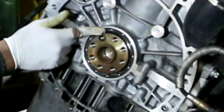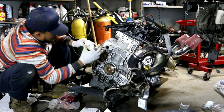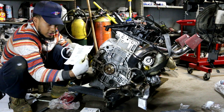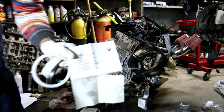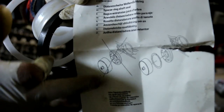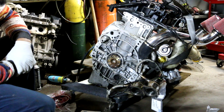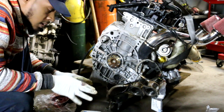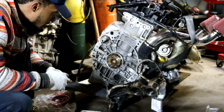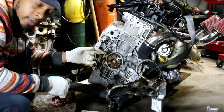This side went in a little far — I hope that doesn't cause any issues. There's a diagram actually showing you what to do. It looks like you're supposed to have another piece like a cup — that's how I figured this white piece was a tool. Okay guys, the next step is to install the flywheel. There is a special tool they use to lock the flywheel in position so you can torque it. I didn't buy the tool — I'm gonna try to use a pipe with a breaker bar on the front to hold it.